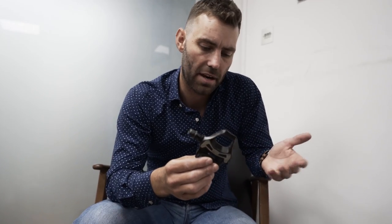They start at the R540, which I'm not a huge fan of — the entry-level Shimano pedal. The cleats don't fit the pedal very well, so they tend to wash around with excessive float. If you're going to buy a Shimano pedal, my recommendation is to start at least with the R550 — it's only about £5–10 more online. Moving up from there you have 105, Ultegra, and Dura-Ace. Fundamentally the engagement system is identical across all of them and they use the same cleats. You get three different options of float: the blue cleat offers 2.5 degrees and the yellow cleat offers 6 degrees — which is what you typically get packaged with the pedals.